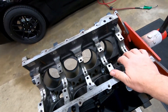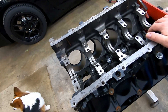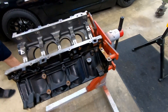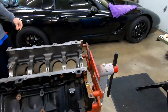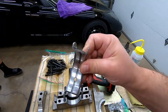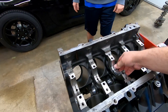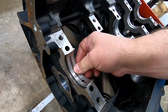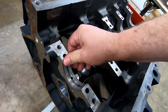All right, we got all of our parts cleaned up and kind of prepped. Went through the bearings — we're reusing the stock GM bearings. They only had like 10 hours on them. It doesn't really matter where these bearings go as far as 1 through 5, but number 3 goes where number 3 goes — this is your thrust bearing. We did mark these. They're set by the locator in the bearing, so you can only put them in one way.